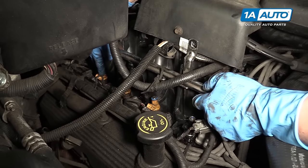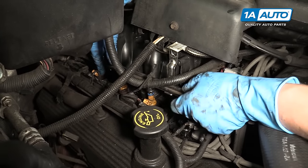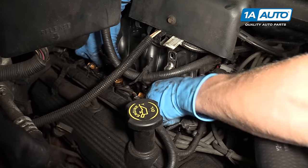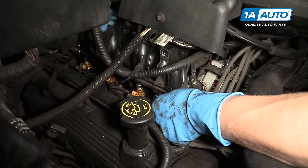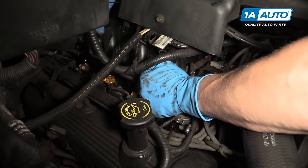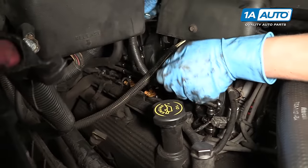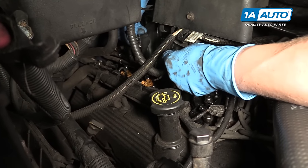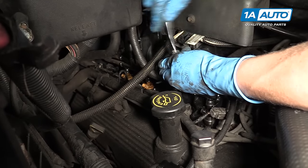With all the injectors in place and the top seal oiled, you can now take the fuel rail and start pushing it down over all of the injectors. I like to start at the rearmost one and work my way up to the front — that's usually the way it works best for me. You'll feel them sort of snap right into place. There's actually a groove inside the fuel rail that the seals slide into, so you'll have a good idea of when it's in place as soon as it kind of snaps down smooth. Now we're going to take these two 10mm screws and start threading them into the intake, then use our 10mm socket and quarter drive ratchet to screw the bolts in.